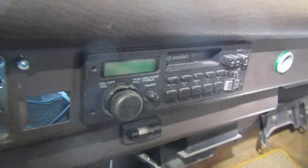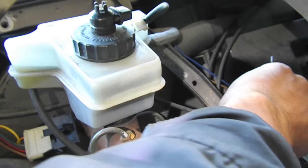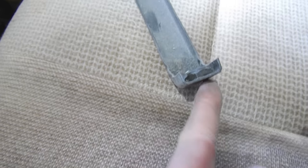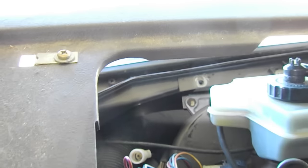I'm going to start disconnecting all of the switches from lower on the dash. All the switches have been removed. I left the stereo in just because I didn't want to disconnect it from the dash itself, but you can unplug everything from the back. One thing that makes it easier is moving this brace out of the way. I took out the other one — this side is where the security screw goes in, and the other side is just a 10mm head that you need to sneak a small ratchet up into, and it connects right there.